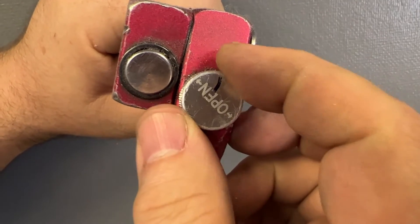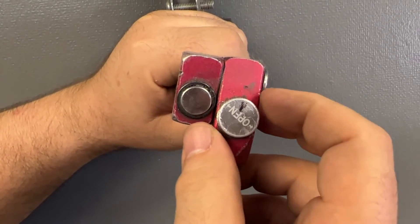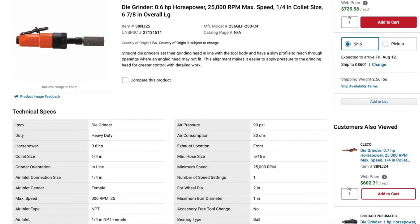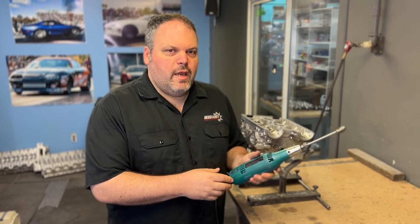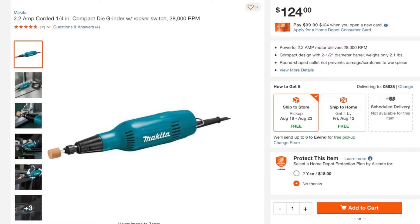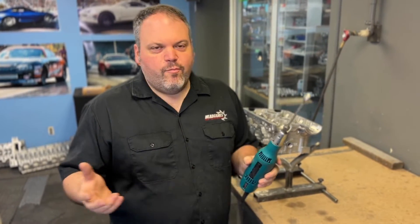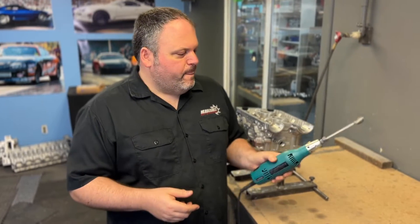Same scenario as the electric — you want to have some kind of speed control. I use a valve here so you can go up or down. You don't want to run everything right off the blast because it's going to be a lot of air. This grinder is pretty expensive — it's like $650. It's not the cheapest thing, but it is one of the best industrial grinders, and it uses a lot of air so you need a big air compressor. You can actually find a cheaper grinder online — Home Depot sells one for about $130. I usually buy a couple because I break the nose a lot. I probably go through about two a year, and I port maybe 60 or 70 heads a year in here, though most of our stuff is CNC now.